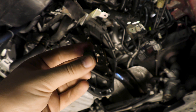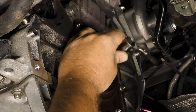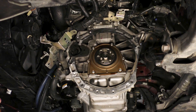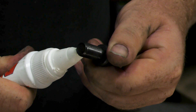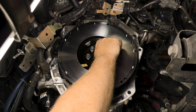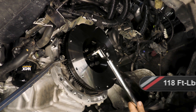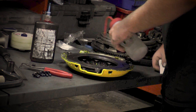Remove the pilot bearing from the crankshaft and then install a new one. Make sure the flywheel mounting surface is free from rust, oil, or dirt. Place the new flywheel into position. Install the flywheel bolts using a thread sealing compound. Tighten the bolts in a star pattern until snug and then torque them to 118 foot-pounds, also in a star pattern. Clean the flywheel friction surface area with a non-petroleum based cleaner. Before installing the pressure plate, make sure to clean the friction surface area with a non-petroleum based cleaner.